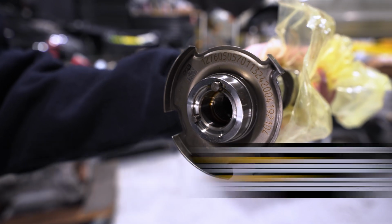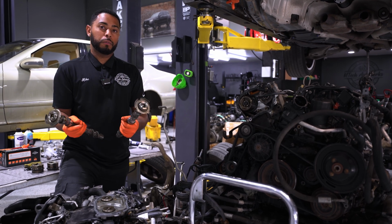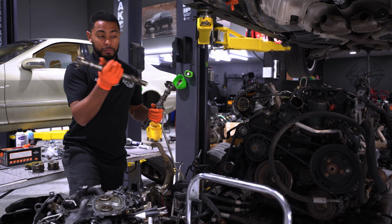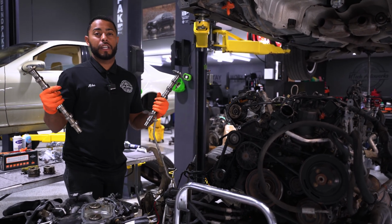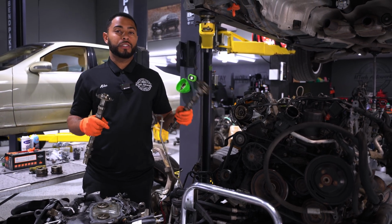You can see these two camshafts are out of M276 engines. It's typically, like I said, because people were ignoring the rattle noise on startup. Then sometimes you'll have to replace your camshaft and your adjuster, which can cost thousands. So if you hear that rattle noise on startup, definitely get it addressed.